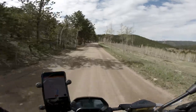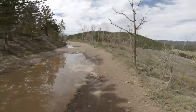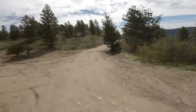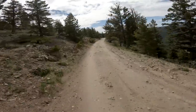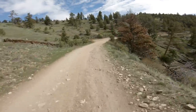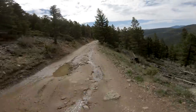Let's ride some dirt. This road will gradually get a little more technical — you can see all the rain that we got with these big puddles. I'm still at 30 PSI because I'm going to go back on the road after this, which is probably not the best PSI to be running off-road, but we are going to run it. Showa suspension doing a good job. The stuff is actually pretty stiff. I haven't messed with any of the clickers or anything. It's fully adjustable — rebound, compression, preload, all that. Nice to have those features because on some other bikes in this ADV category, you don't have that option. The way it's set up out of the box right now, it's feeling really good.